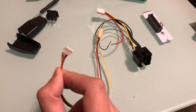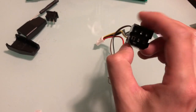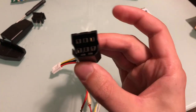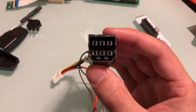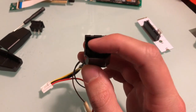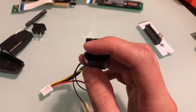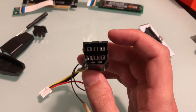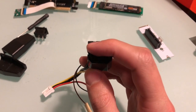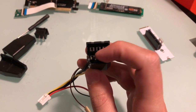Let's take a look at the Xbox 360 female adapter and go over the wiring diagram. Depending on your Xbox 360 power supply, you'll either have two or three pins per row. The top row is the neutral line, so if you have the 200 watt Xbox 360 power supply, you'll get all three pins, and you're also going to get three pins for the 12 volts in the middle.